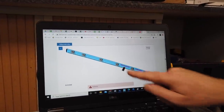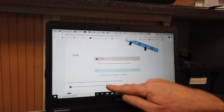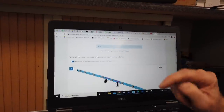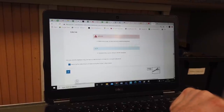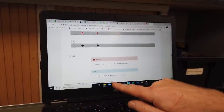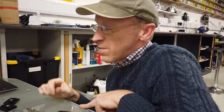We've got to drill a 90mm hole - hence my other video on drilling 90mm holes, I'll put the link to that later. So we've got to measure the centre point of here, take this strip back off, and then drill it. The instructions say you can remove some little bits of metal - it says removing the metal strips will make drilling the two holes easier. On the Defender 90 short wheelbase, the bits of metal are in the vicinity of where you've got to drill. What drill are you going to choose, Tyler? The hole saw!